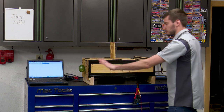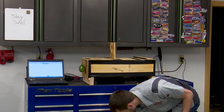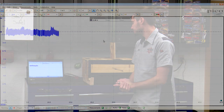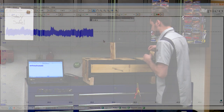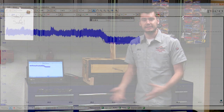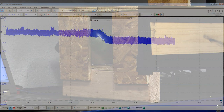We're going to run it normally for now. Don't tell my son I stole one of his water balloons — that's what we're going to use to show airflow. Scope is set up and running; let's go ahead and flip on the jump box. We're pulling right now about 11 and a half amps on high speed, and we have a nice airflow coming out the backside of our case. Now we're going to restrict the inlet air going into this heater case — and our current goes down just like it did on the F-150. What I find really interesting: when we have a severe restriction on our inlet side, we're actually kind of pulling the balloon into the HVAC case.